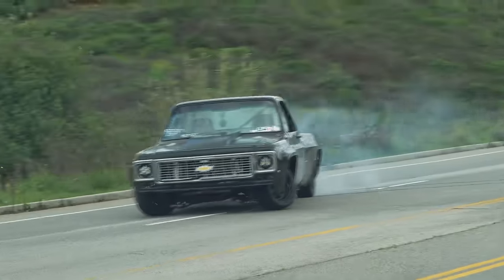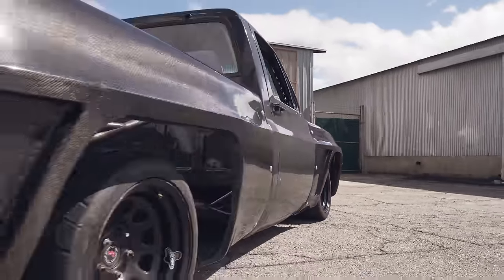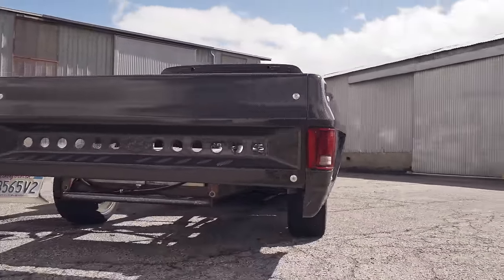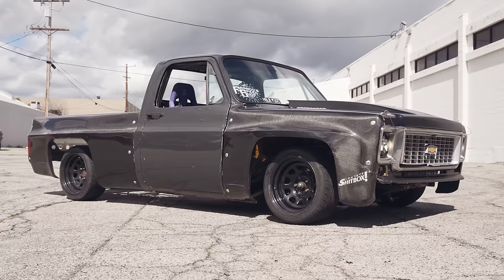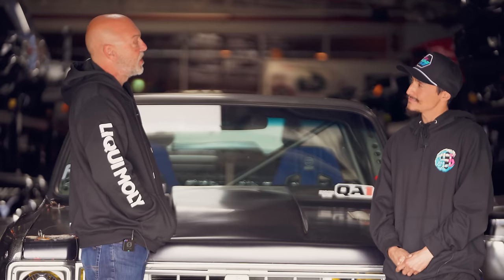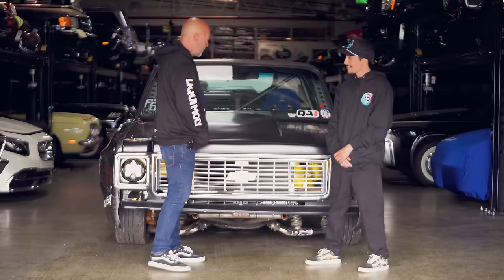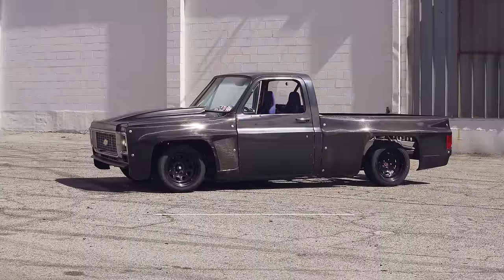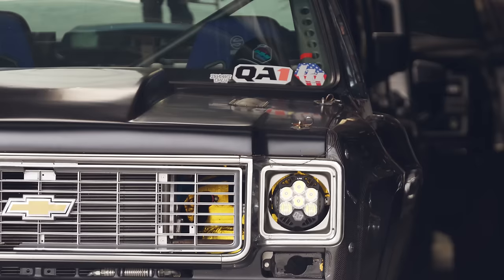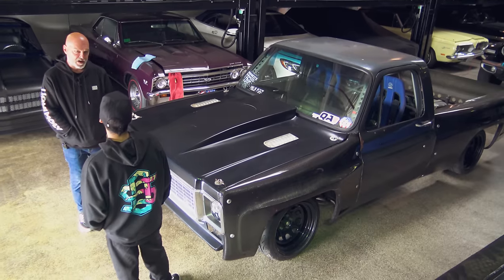All I know is this thing is definitely a driver - you prefer being sideways rather than straight. It just handles better that way. So you built this purposely as a full drift truck, correct? It wasn't originally supposed to be an autocross truck when I started the build, but after a ride-along with a buddy in a drift car, my mindset changed completely and I had to make this a drift vehicle. The truck's a '77 - the whole flooring and firewall got cut out and the motor pushed back quite a bit. Did a bunch of framework, boxed it all in, channeled it, reinforced it.